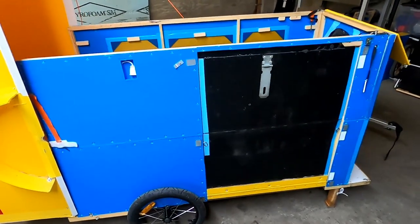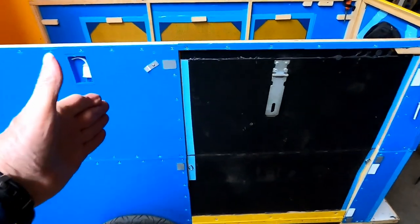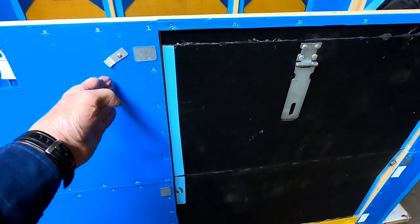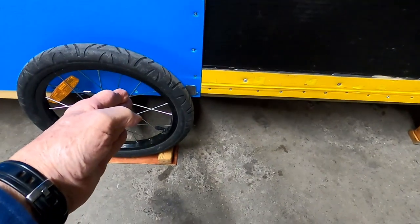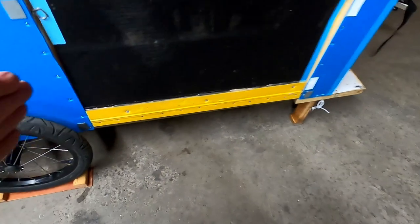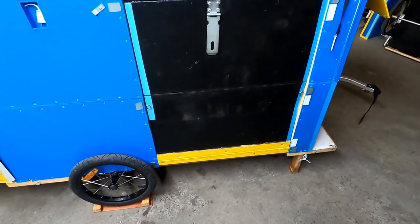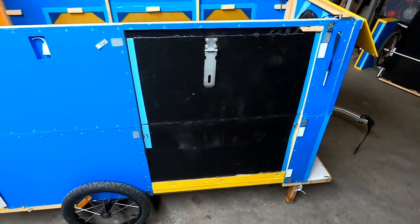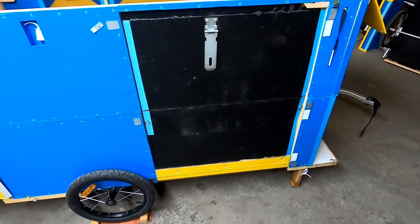More about the platform door. The original door entrance on the right side and the lateral pullout on the left side were 30¾ inches wide, and because they overlapped the wheels, I had to pop the wheels off when I expanded the trailer to put it in camping mode. But to leave the wheels in place in camping mode, it was necessary to trim the pullout and the door by 4¾ inches.